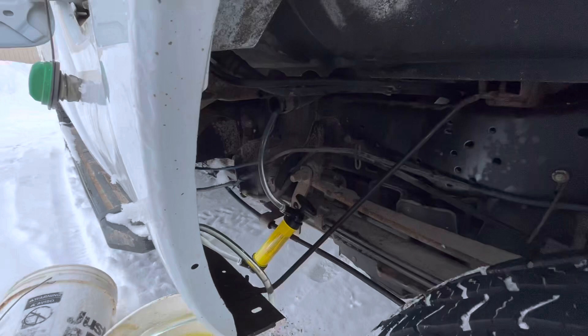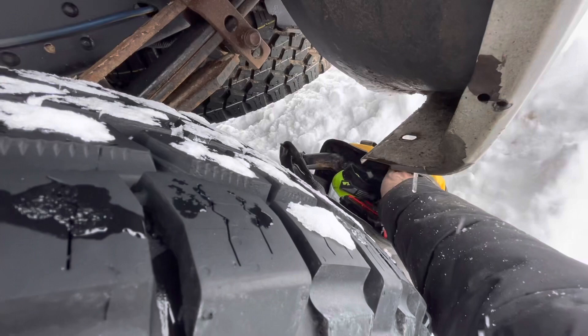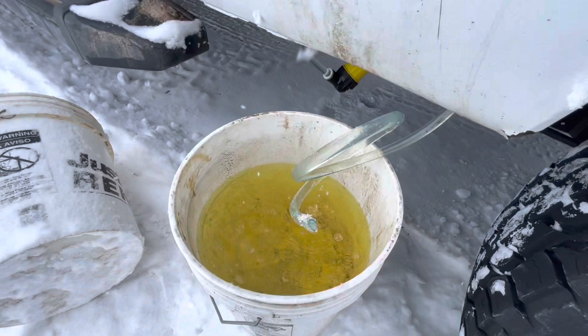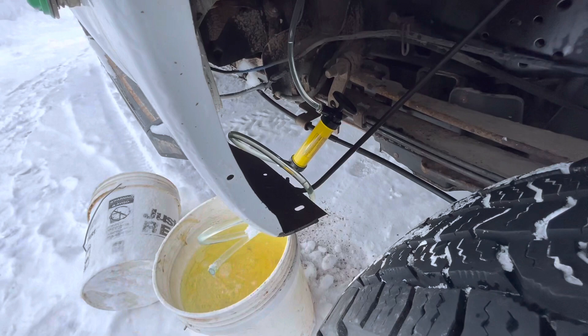On this 2014 F-250 I had to take this off because the hose wouldn't thread down, kick across, and make a 90-degree and go straight in — I just couldn't jiggle it around enough. So I had to take off this piece to give myself a little more space so I could jiggle it in, and then I bought this $20 pump so I didn't have to suck the gas out. This pumped really well, got it flowing pretty strong.